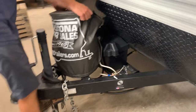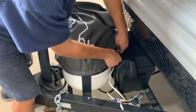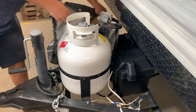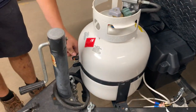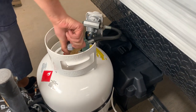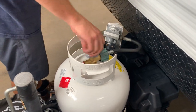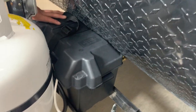Up front, you have this cover on there for the propane — it just unbuttons like so and you can take that cover off. It gives you access to the propane tank; to loosen it off you just have to loosen this wing nut and you can pull the tank right out of place. You've got your tongue jack, and to open up the flow of propane you just go counterclockwise with the valve. Located inside this black box is going to be your Group 27 RV battery.